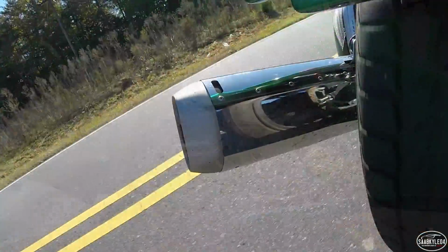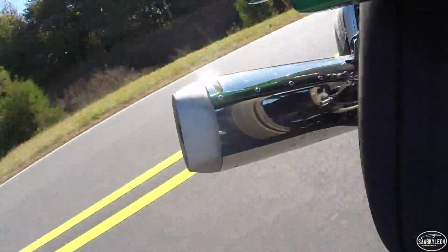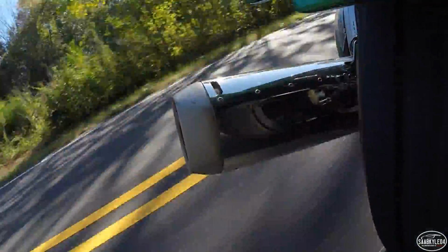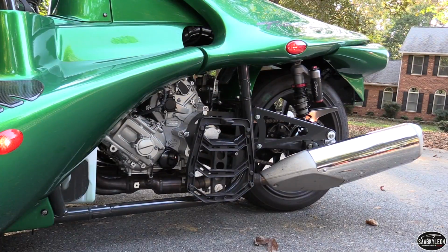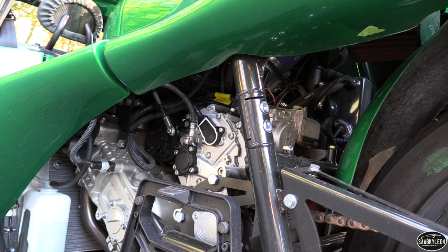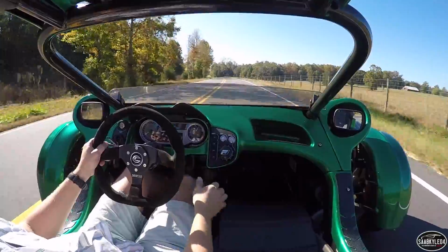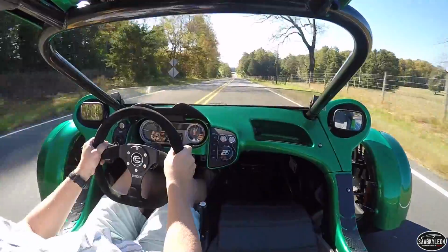1,649cc BMW inline 6-cylinder that delivers 160 horsepower at 7,750 RPM and 125 pound-feet of torque at 5,250 RPM. It's an oil and water-cooled 4-stroke engine with 2 overhead camshafts and 4 valves per cylinder. The compression ratio is rated at 12.2 to 1. Being that the whole vehicle weighs around 525 kilograms or 1,157 pounds, it's able to rocket to 60 miles an hour in about 3.9 seconds and pass through a quarter mile in 12.6 seconds. The power-to-weight ratio is 5.27 pounds per horsepower.